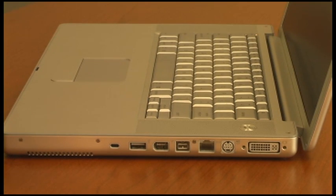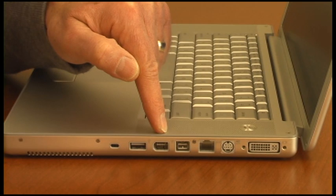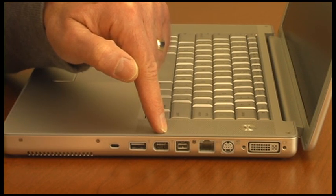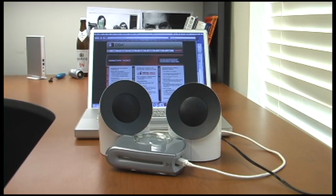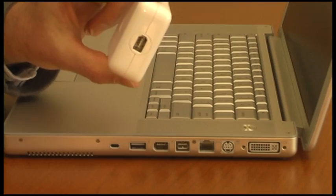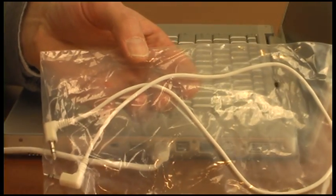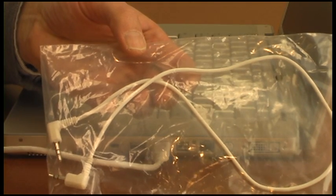As you would expect the FireWire speakers are very easy to use but there are a couple of things I should point out to you. First of all it's best if you can use a six pin connector — both the audio and the power go over the six pin. If you only have a four pin there are a number of things you can do: you can use external power supplies, a powered repeater, or the power brick off an old iPod. As an alternative, you can just connect your speakers to the headphone jack on your computer using the cable provided.